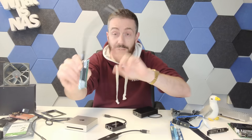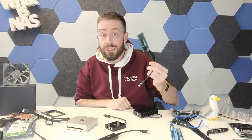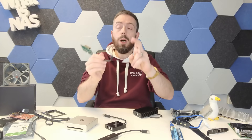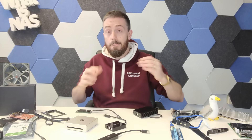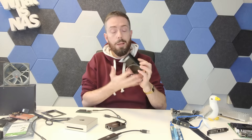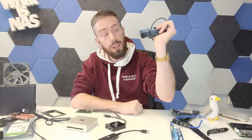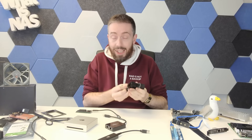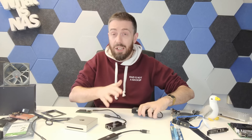USB 4 connectivity has really opened the gates. We already talked about the USB 4 to PCIe upgrade PCB adapter, which opens the door to PCIe upgrade cards — including larger 25G and 40G cards, keeping in mind you've only got 40 gigabits per second to play with, and driver compatibility is a consideration. USB 4 and Thunderbolt 4 support also means you can take advantage of things like the Sonnet Solo 10G, which attaches via bus power through a Thunderbolt connection and adds a 10GbE upgrade port. OS support is a factor, but it opens the door to external upgrades on your NAS without heavy tinkering — hugely beneficial for very compact systems.